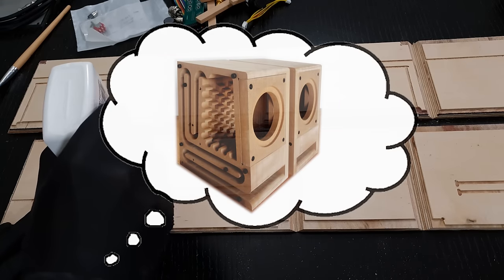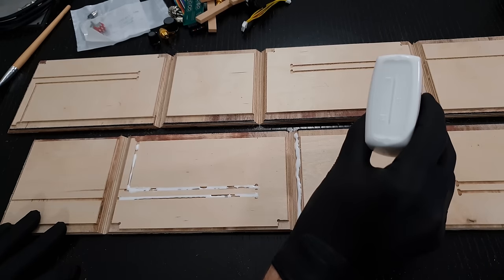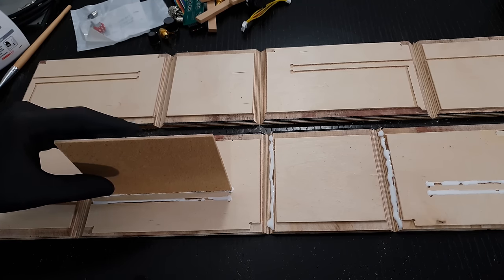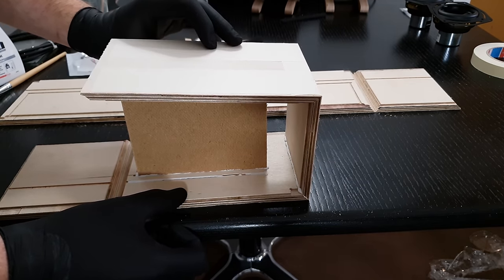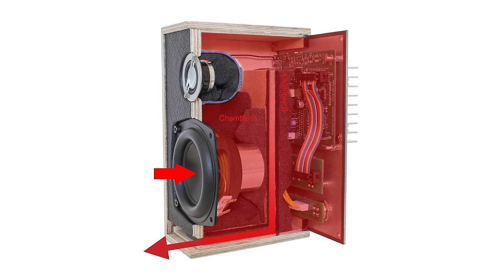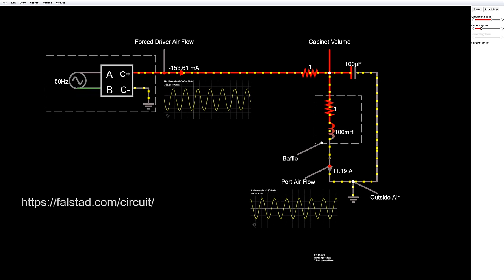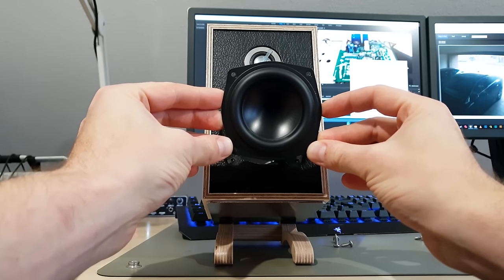I'm going to listen to the speakers without prejudice and let them justify the plywood, though I can't quite stop ideas forming that involve 3D printing and concrete. After cleaning the CNC-machined features and applying wood glue generously, I want everything to be airtight because there is some aerodynamics involved. The internal walls form a narrow baffle — when the driver moves, it restricts airflow and forces it to travel a longer path. Not sure if the short transmission line justifies the prestigious title of a transmission line speaker, but even as a bass reflex system relying on port airflow lagging the driver by exactly one period, the result is constructive interference causing automatic amplification.